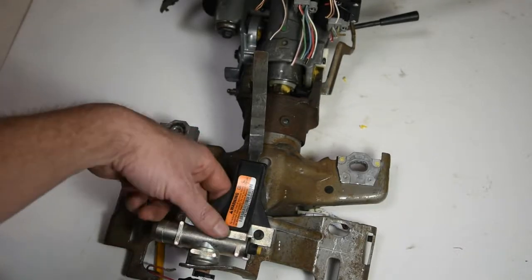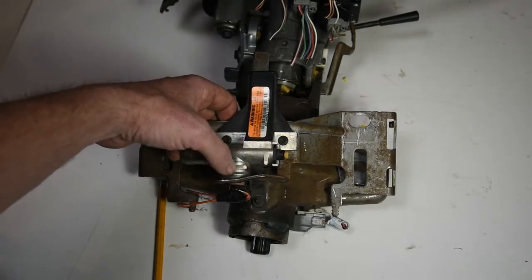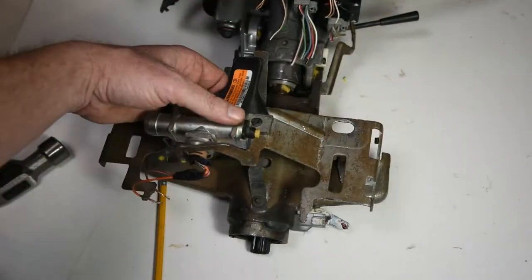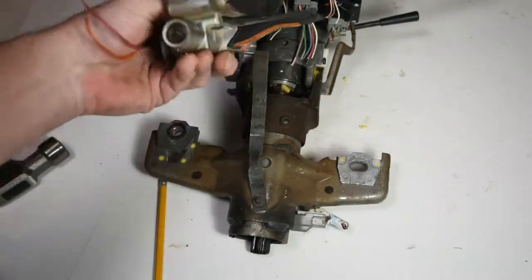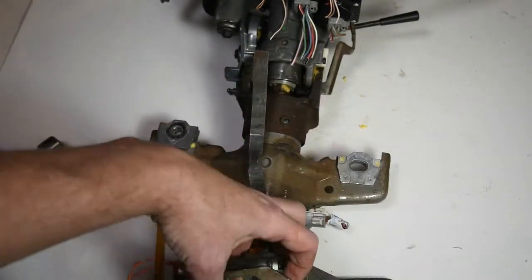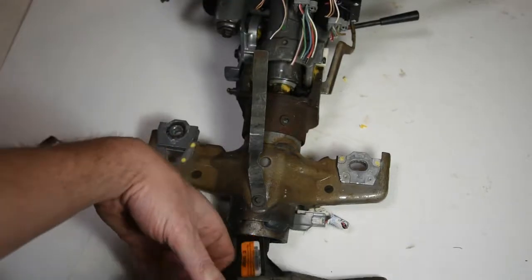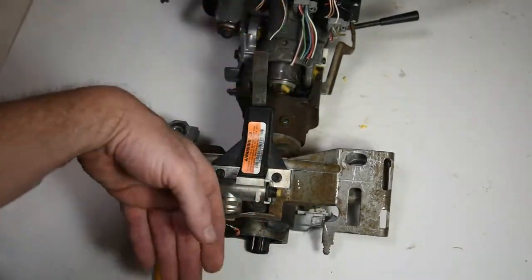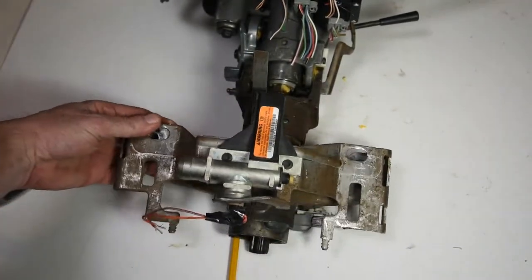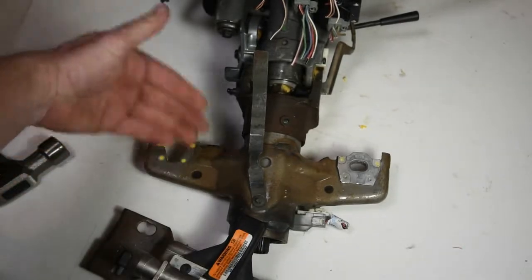I tapped on it with a hammer and chisel and they came out pretty easy. So we just bolt this in. The airbag computer sees that there's a collision, sends power and ground to this device, and fires it off. It slides off the strap — inside it just blows some plastic that breaks, and some of them pull a pin, basically releasing the strap so it can slide up and off. Then the steering column can slide down while the aluminum pieces stay solidly bolted up under the dash to the frame, while the steering column slides down.